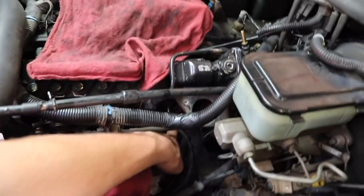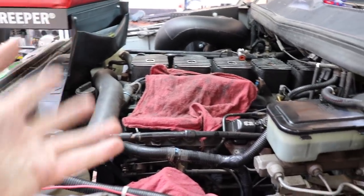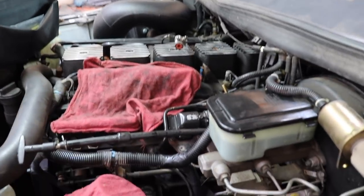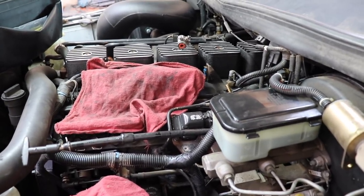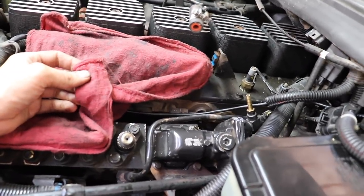It's real easy. Well, that just opens up the access to get to the big bolt head that's right there to take that out so you can turn over your engine slowly and then center up your governor springs and swap out both sets of those, and then that's a fairly easy job. But today I got the AFC housing taken out. I did the star wheel adjustment.